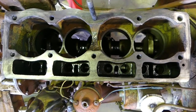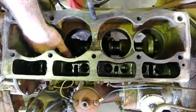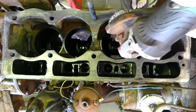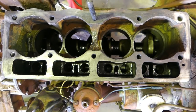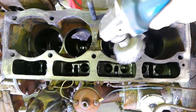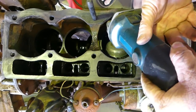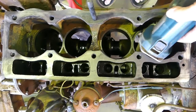To clean inside the block I often leave the liner seals in so I don't damage that surface. You can use an angle grinder with a three-inch wire brush, but the guard gets in the way. I'm not telling you to do this because it is dangerous — you really have to have your wits about you. I've taken the guard and handle off and I hang on for dear life, running it up and down inside the bore to get it as clean as possible.